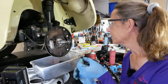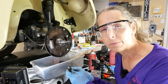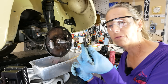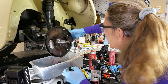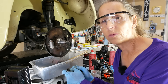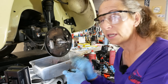This has turned into a bit of a job. I've removed both shoes and we've got wetness pretty much all the way across — this is really a mess. I'm going to clean everything in here and look into either a rebuild kit for this cylinder or just a new one. They're probably not very expensive and probably easier to just replace. I'm also cleaning all the adjusters so they work properly, since frozen adjusters make adjustment impossible. We're also missing the little rubber boots that go on the back to keep water out of the brake system. I'll also inspect the bearings.